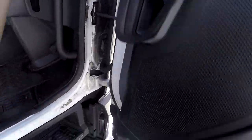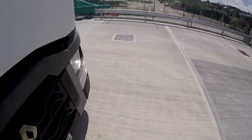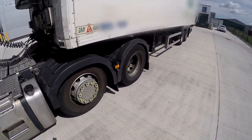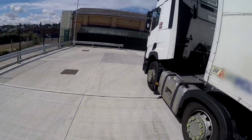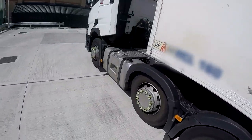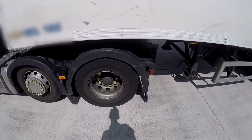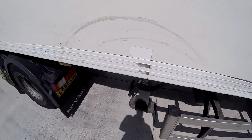The way it's taught in a lot of schools is through a method called 'black and then black but backwards.' But honestly, I find that more confusing than it needs to be. I think it's easy enough to remember that if you're uncoupling, you start on the left of the lorry — so you start with the legs and the brakes. And if you're coupling back up, you start with the kingpin. You've got to use common sense really — you don't want to take the kingpin out if you've got your legs up. So anyway, we're uncoupling.